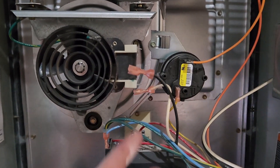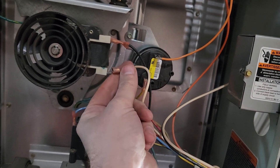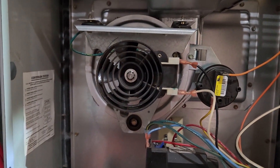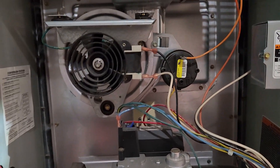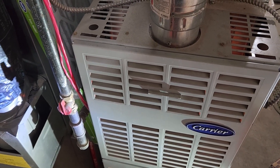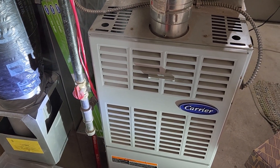My black connector was a little loose so I gave it a quick squeeze with needle-nose pliers to make sure it has good solid contact. Slide the panel back into place, switch the breakers back on, and fire up the furnace. It's not perfectly quiet but it's a lot better than it was — you can still hear the bearing noise a little, but it's far from the screechy squeal it was, and it seems to get quieter the longer it runs as the oil works into the passages. Hopefully you found this video helpful — hit thumbs up if you liked it, and leave any tips or corrections in the comments. Thanks for watching.